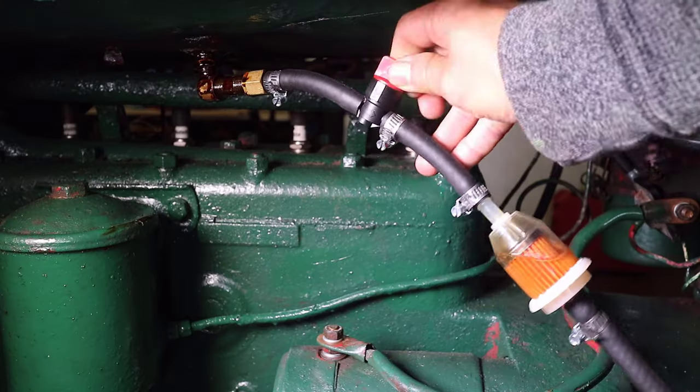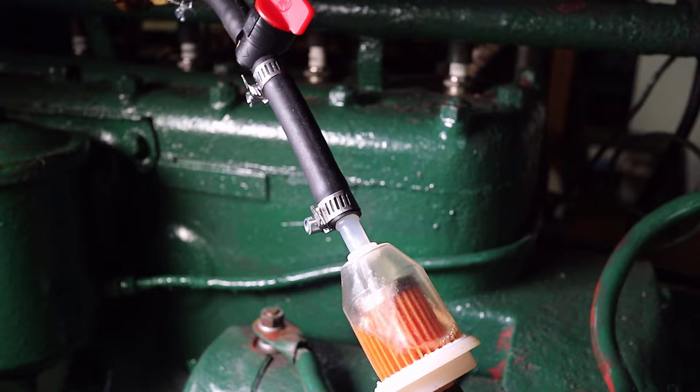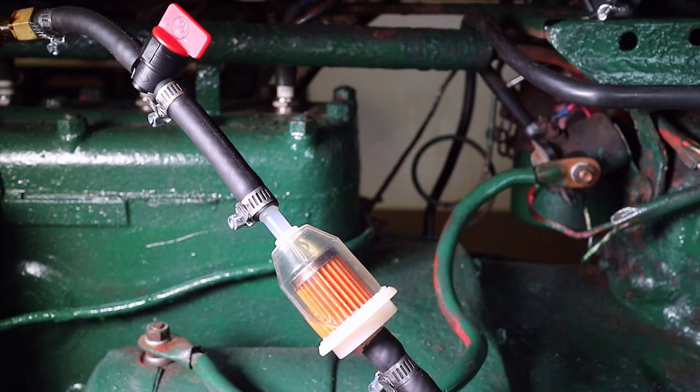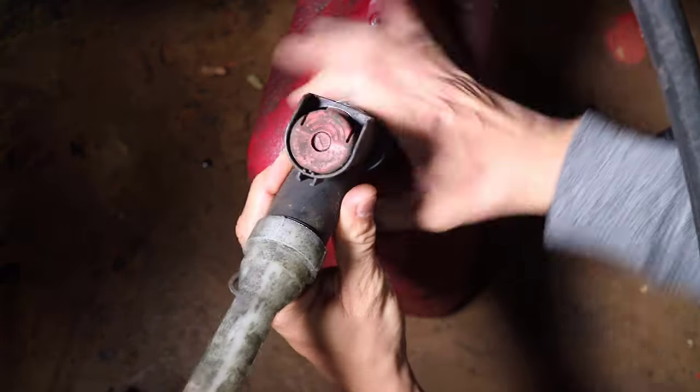To remove the hood, the fuel line from the fuel tank to the carburetor would need to be disconnected. This was done by clamping the fuel line at the carburetor then emptying fuel into a fuel can. The fuel line could have been emptied below the carburetor, but it would be easier to pass the fuel line to the other side, because the fuel shutoff valve was located on the other side.